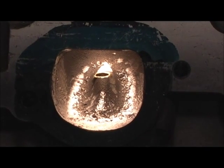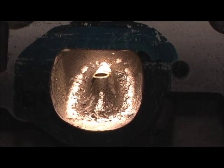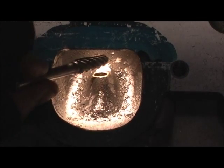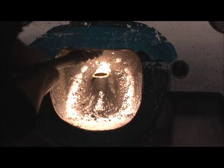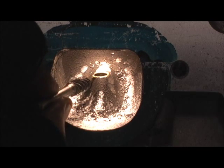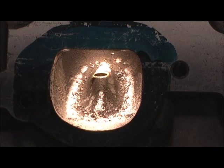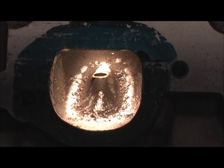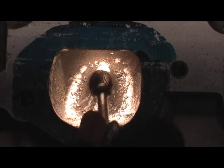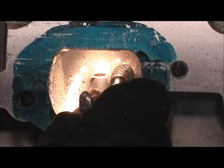Back on the exhaust port a little bit. I didn't actually get this part, but the exhaust guide was protruding up about a quarter inch — a hair above it. What you had was uneven pour of the aluminum on each side of the guide. So what I done was I went to a rough carbide — actually this one right here for cutting steel — cut it, leveled it down, and then rolled on the sides.